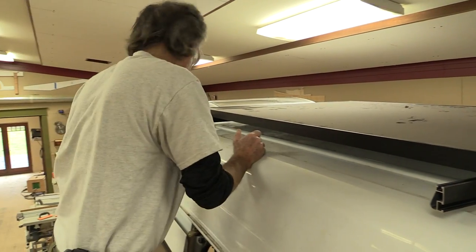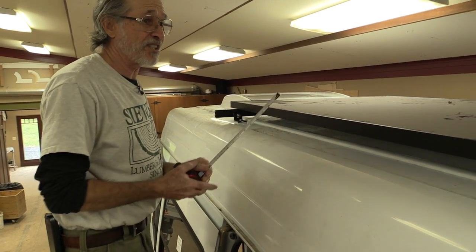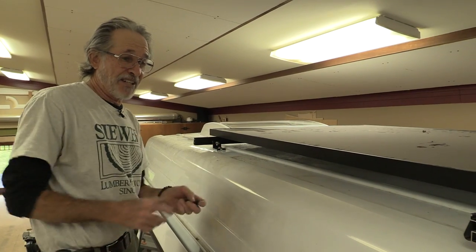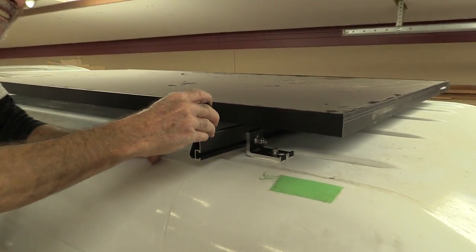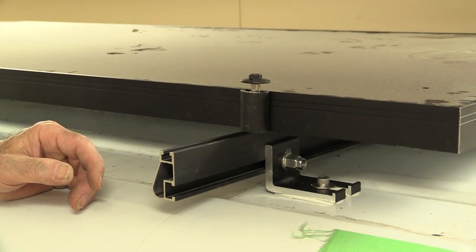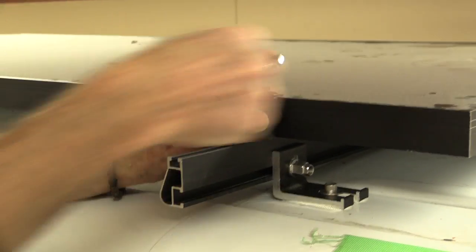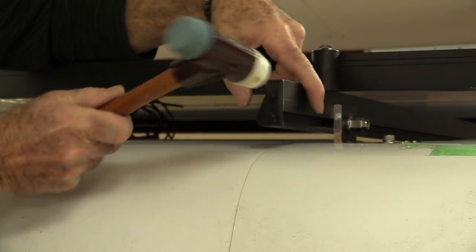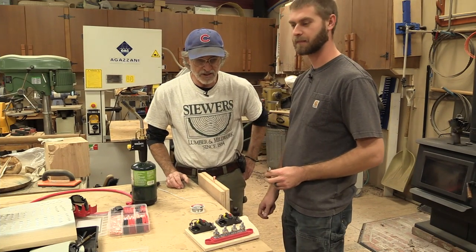Five inches there — that's exactly what I had on the other side. And five inches here, so this thing's perfectly centered on the top of the truck. We checked the measurement from the front to the back. Now all I have to do is slide these little guys right into this slot, then turn it and this will butt right up against the frame. And I've got little caps that they sent with the solar kit. Done — and remember, there are rights and lefts.